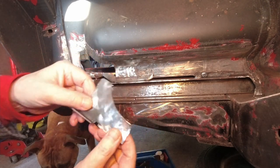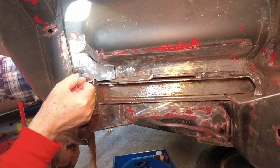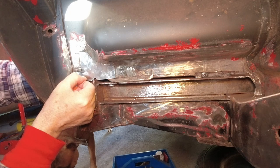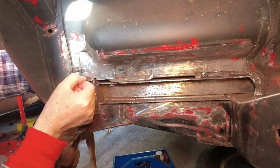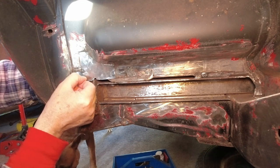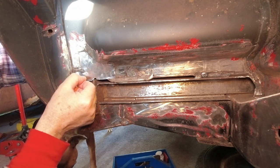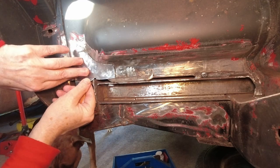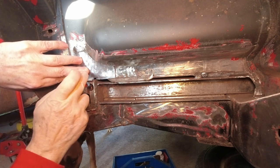Now we're going to offer it up. This is the bulge panel — the bottom of the bulge panel — and this is pretty much where it goes. It'll need a small bit of fettling to get it into perfect position. It'll have to be pushed in and pushed out here and there as we tack it, because things get pulled in directions you don't know until you actually put that tack down. Critically, this is the fold right here, and this is in line with the manufacturer spec — it kicks out here, and that was the idea of the 90 degrees.